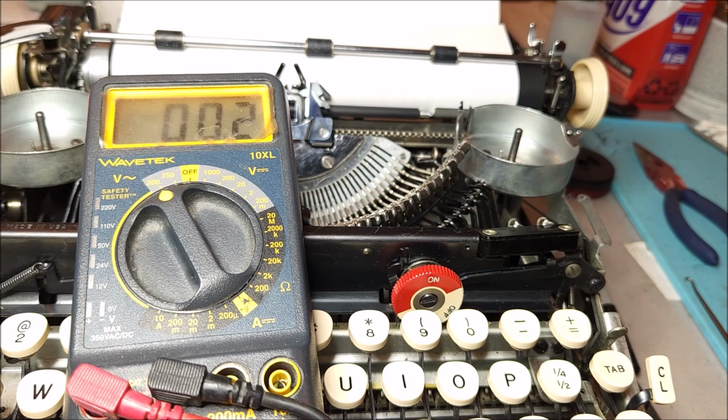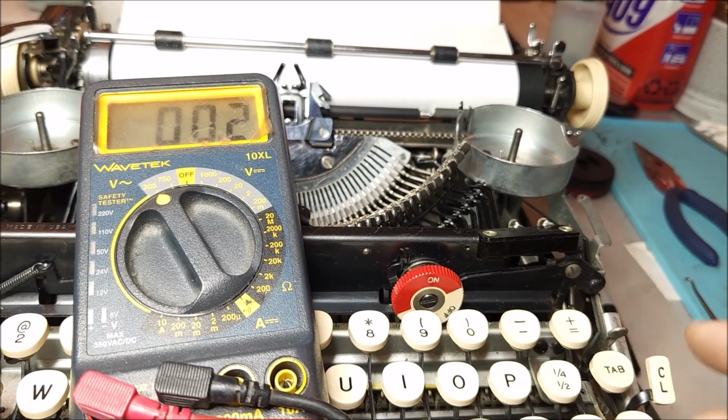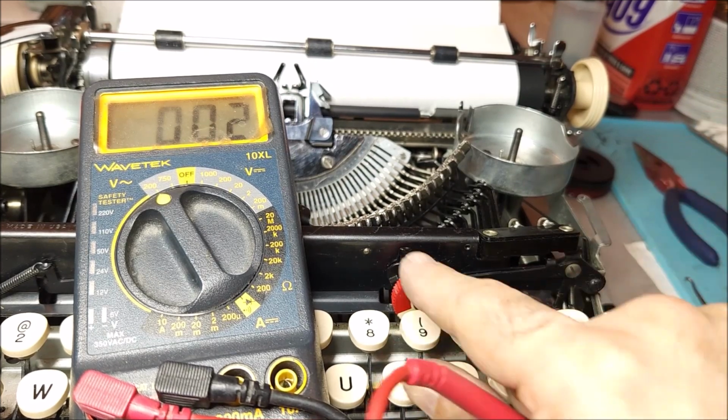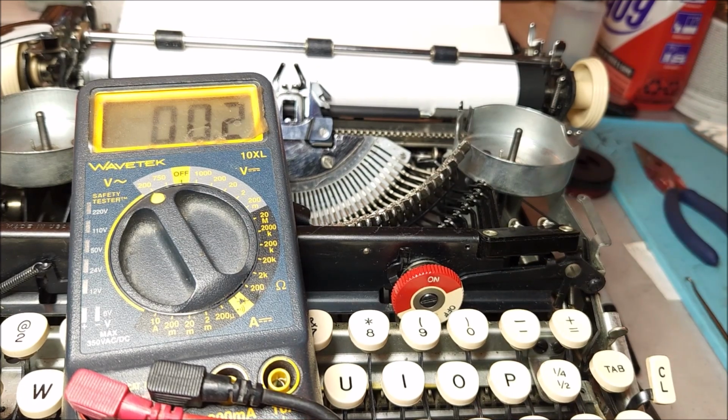And that is independent of this, because the line voltage is coming into one, then you move the block and the safety, it depresses the switch, and then the line voltage goes out the other connection back into the transformer, back into the motor. So please make sure that you understand that anywhere that there's a power cord in this unit, you are dealing with 120 volts power and whatever the circuit is capable of providing. So please do not treat that lightly.